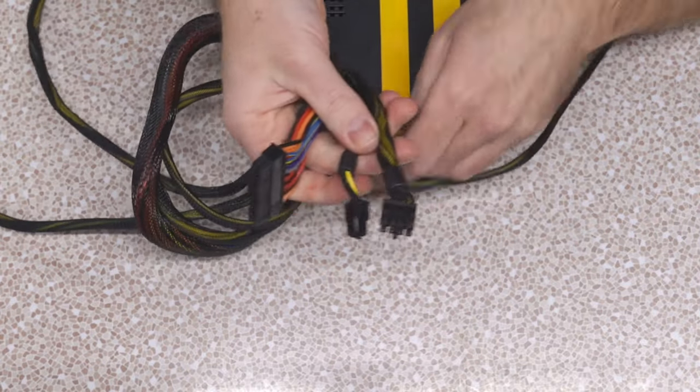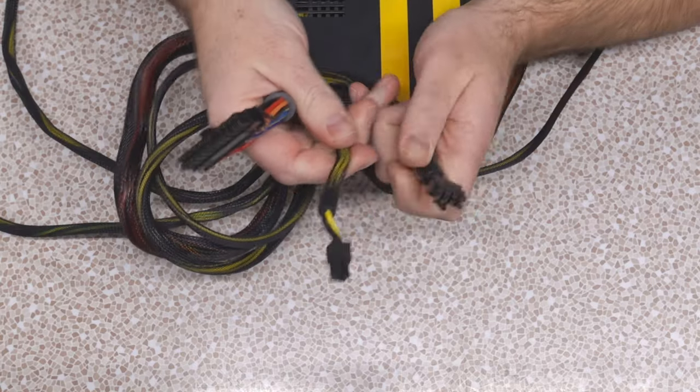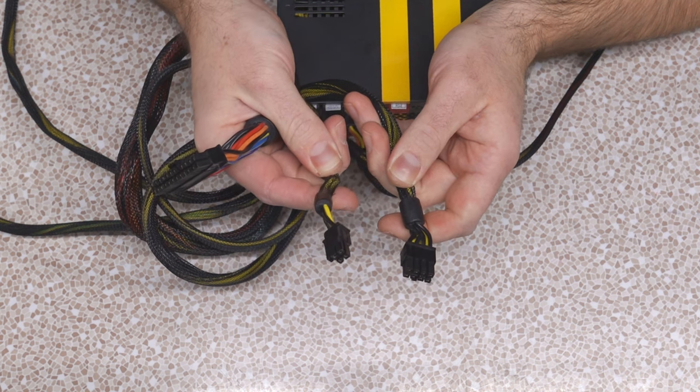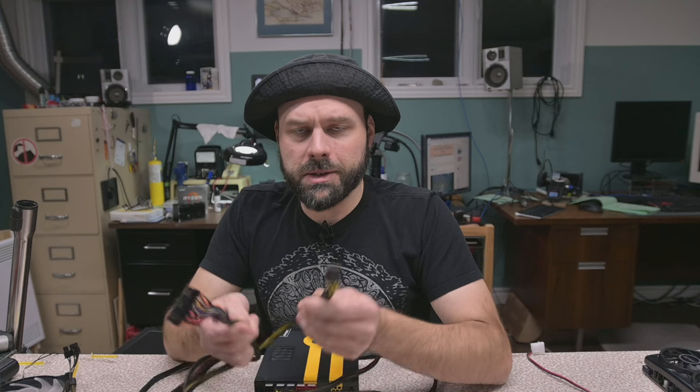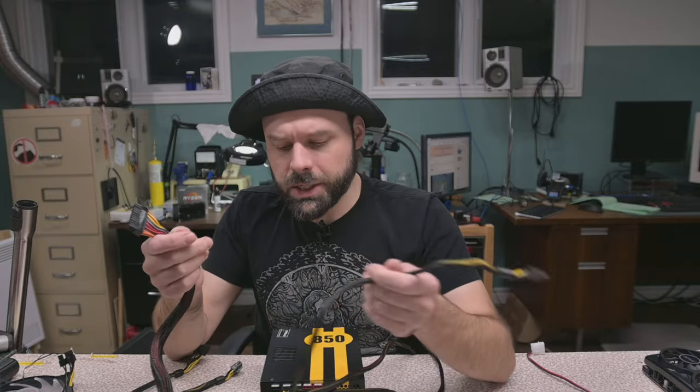So your CPU connections, like your ATX 12 volt and your main motherboard connector, they were on rail one. And it sucks because you kind of had both the 4-pin and an 8-pin. So if you only needed one or the other, and chances are you were using the 8-pin, then you'd have this stupid 4-pin stuck on there that you had to tuck away.